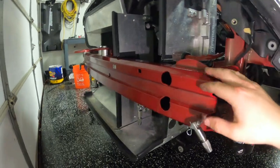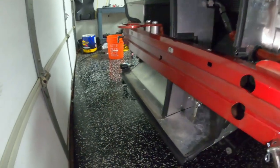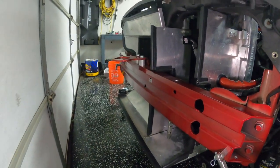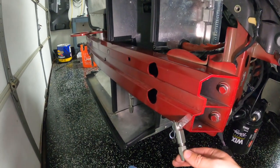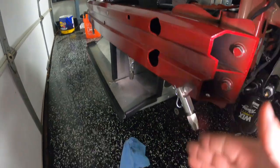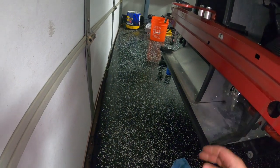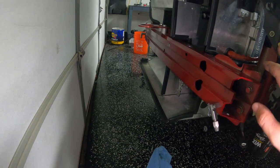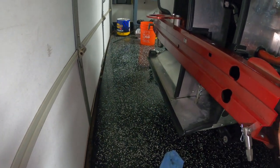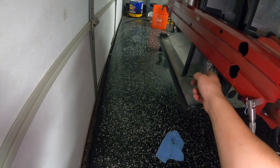Afterwards, I was able to pull this off and get those holes drilled. You can see I got a hole drilled right there, then I drilled through the middle layer from the top, and then the bottom layer from the bottom. I've installed my rod mounting points — the ones for the outer edge and the middle ones. While these look relatively close together, keep in mind one goes at an angle and the other goes straight forward. I think the next step is to put on the front bumper cover and confirm where these are going to pop through on that front lower grille, then pull it off and cut the slots for these to come through.